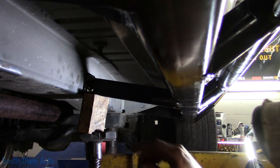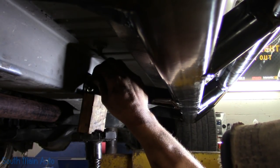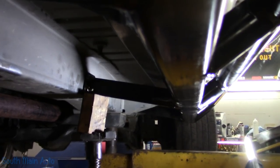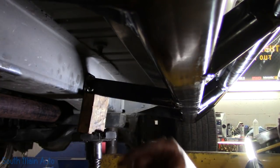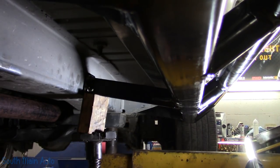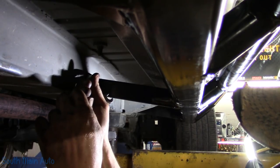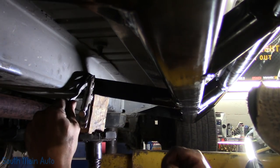And then, like I said, if you're using longer bolts, or bolts even like this, just grab it with a pair of vice grips here on the end, and then you can wrench it on. And then usually what I'll do, or what I did in this case, so I didn't have long bolts sticking on, I just stick the cutoff wheel and nick them off on the end so they're not hanging way out. I guess I can demonstrate that for you. Because this is how I finish setting them up, because that impact's actually pretty weak. Say just needle nose vice grips, yeah, it boogers up the threads, but it really doesn't matter.